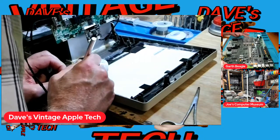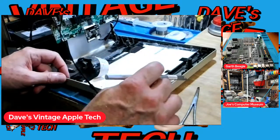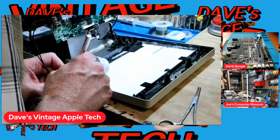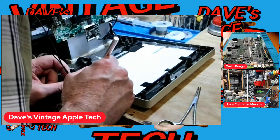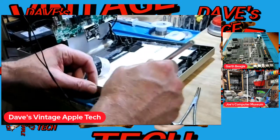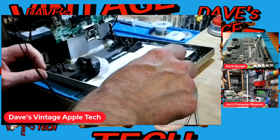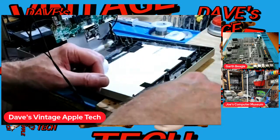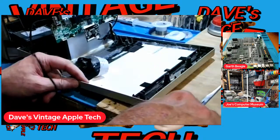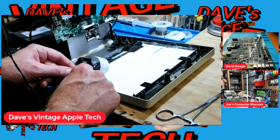If the FPI chip is bad, it's basically a parts board because you can't get those anymore. Oh, really? What does FPI do, Joe? Fast Processor Interface. It effectively glues the non-Apple II part of the machine to the Apple II part of the machine. We have to keep the machine slow for compatibility with all the old Apple II stuff, with the faster, better-than-Macintosh Apple thing. It supports talking to the battery RAM, shuttling data in and out of what's called the FF space, where the emulated Apple II stuff is, and stuff like that.